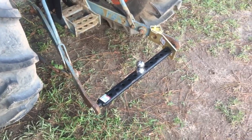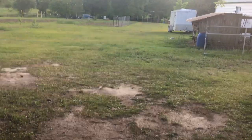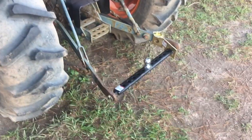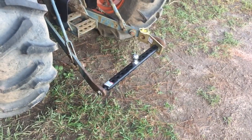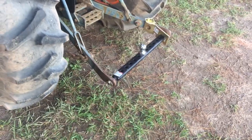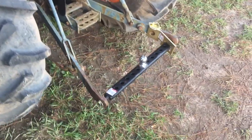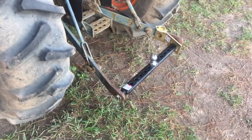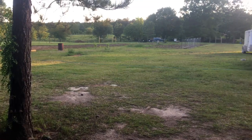With this two-inch ball we can even pick up slightly larger trailers — like that one over there which has the two and five-sixteenths — and we have no safety issues when the trailers are loaded. If for some reason we were dragging an empty trailer with very little tongue weight, we just swap out the ball; I have the right size ball for that. Right now it's easy to take on and take back off, and where it really shines is when we have to take the lawn mower out and mow all of this.